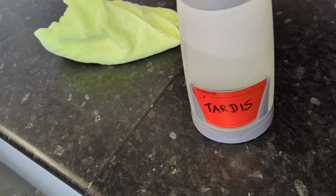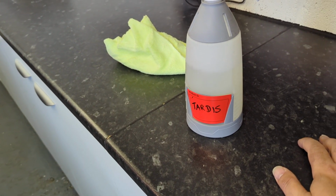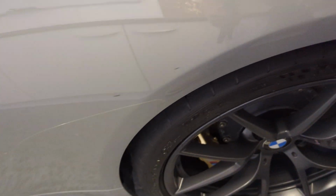It's very strong. Just be careful with it if you've got any wings that you've bought from eBay pre-painted with a rattle can, or some Mickey Mouse acrylic clear coat, and you put loads of this on and let it dry in the summer. If you heavily misuse a very strong solvent-based product like this, you can potentially come a cropper, but you won't if you follow basic rules. Just don't let it dry on the surface, and that is really it. Yeah, just a very useful product.